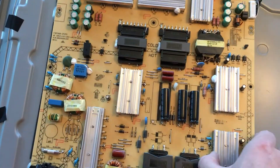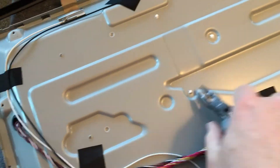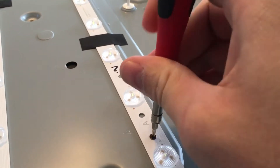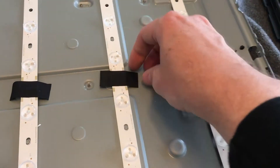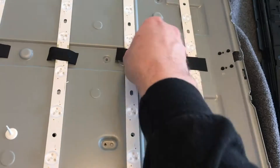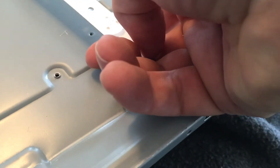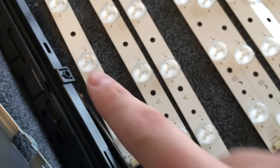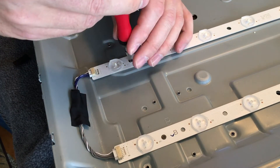These are little holders that hold this reflection panel — it's like a white piece of vinyl plastic. You have to pop all these tabs to get it free so that you can access your LED lights. I thought it was an LED light problem, so I was replacing all my lights. I went through and yanked every single light strip off. How I discovered the real issue: I was testing the new lights and the new lights wouldn't work where the same old lights didn't work. Obviously this isn't an LED light strip problem. They just plug in — one screw holds them together and the rest is held with tape.